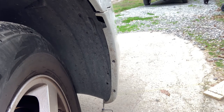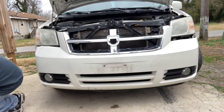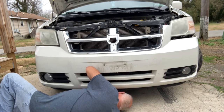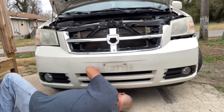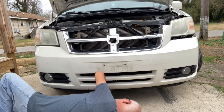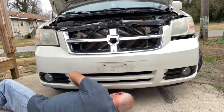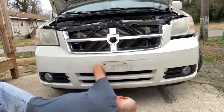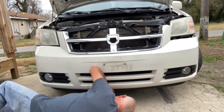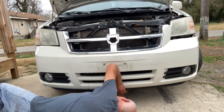That's all that's really holding this part of the bumper on. Now comes the fun part. I did not put the camera underneath the car for this as it was dark under there — even a flashlight wouldn't have done it justice. There are four plastic tree clips that just push straight into the plastic underneath the car. Those trees are holding the black air dam onto the white part of the bumper. I found it much better to just grab the air dam, pull it straight down, and pull the tree right out of the plastic, rather than trying to get a screwdriver in there.